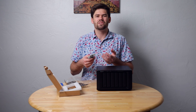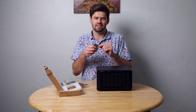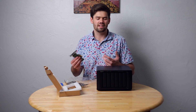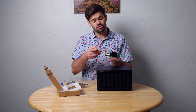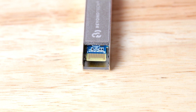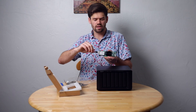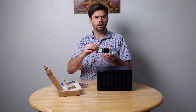I really wish they would include a black option because their entire case is black and then there's this white thing that sticks out. It's not the biggest deal, but it's just an OCD thing. Right here is the card — it has two SFP Plus connections on there, which is a much larger module. So this is a DAC cable; you basically just slot it in there and it latches. They always come with a little puller that you use to unlock it.